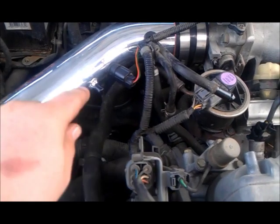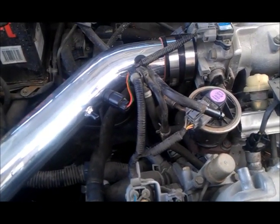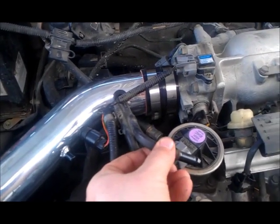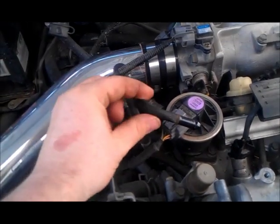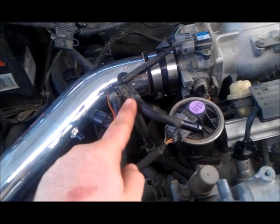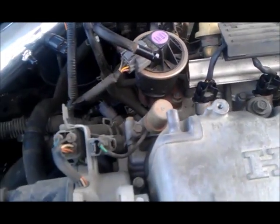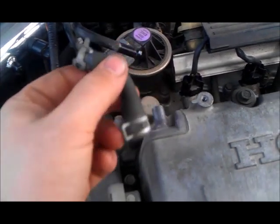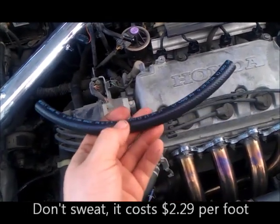AEM gave me two rubber grommets for the intake pipe — one for this hole, which I slid the sensor into, and the other rubber grommet for the PCV breather hose. I was trying to use my stock one, but it's really metal and hard, and all these are linked together with a clip and I can't get it out. I slid the pipe into that grommet, but found out that this end was a half inch too short to clip on. So I just went to an auto parts store and bought a foot of three-eighths hose.